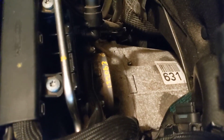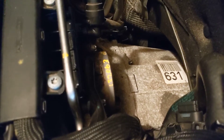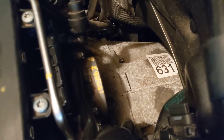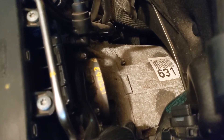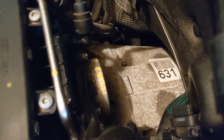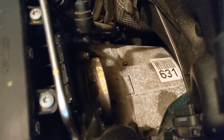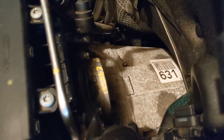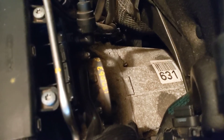I had mentioned that you need the CLK 550 throttle body. I do have that now — it's a junkyard part. This is actually off of an E550, so it did fit properly, it's the right size. So it's not specifically the CLK 550 throttle body needed for the 82 millimeter swap — just one of the throttle bodies off of the naturally aspirated 5.5 V8 will do. Make sure you are looking at the NA 5.5 such as the CLK 550, the E550, or the S550, because the AMG part will not fit, presumably because most of those are accommodating forced induction.